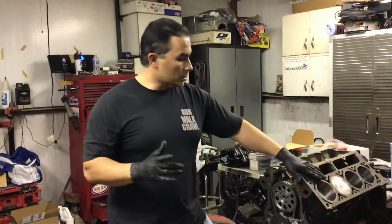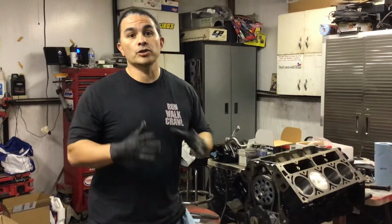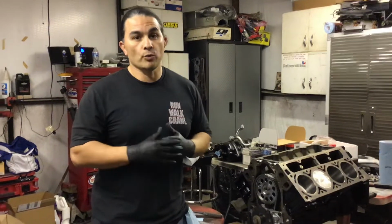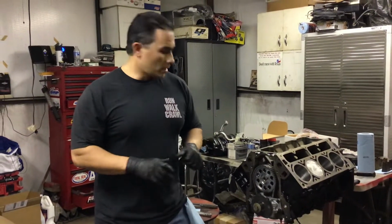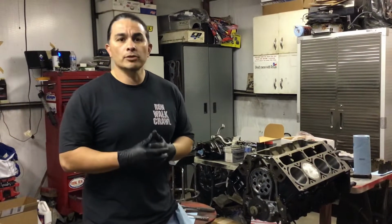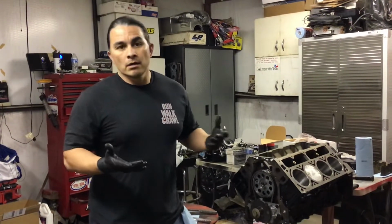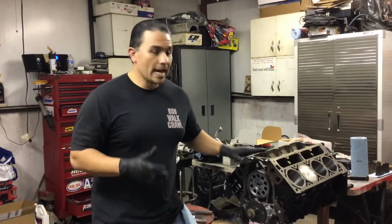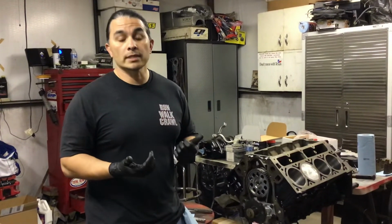Again, it's just a stock bottom end. Stock bottom ends are good for over 1,000 horsepower as long as you gap the piston rings. That is your weak point. Other than that, everything will work good as long as your tune is good. I'll give you the cam specs on the next video. I need to look them up. I do have the cam card, and on the next one I'll give you the cam specs on it, so you'll get the same horsepower range that I'm looking for. So again, this will be an easy 800 horsepower engine, a daily driver. I can tune it to make more than 1,000 horsepower if I want.